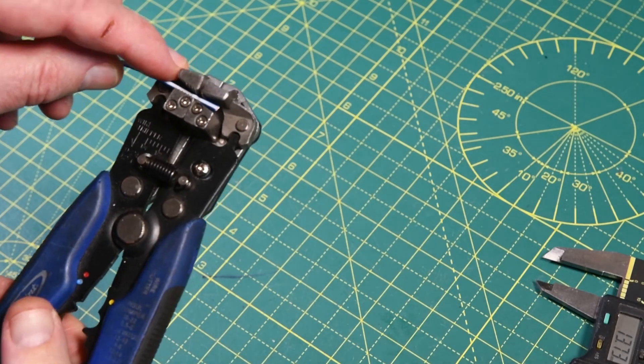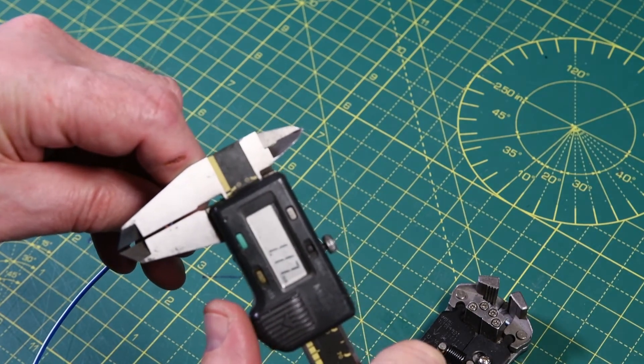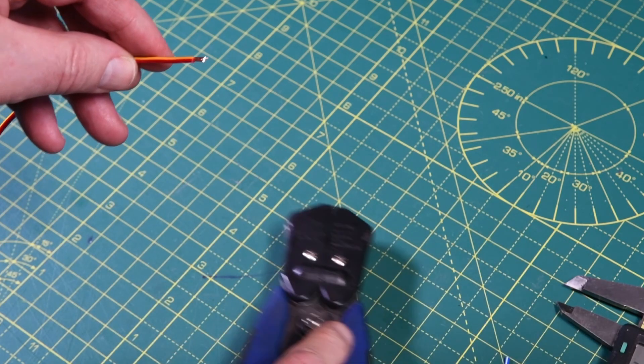That's the O-level maths bit done to show how the wire is measured accurately. We have discovered that sufficient numbers of people are under the misapprehension that to measure wire, one uses a caliper around the insulation. This is very much not the case. If you strip back the insulation and give the strands a gentle twist and measure the copper, that will give you a better idea. The diameter of the copper on 1mm wire is roughly 1.2mm, and 2mm wire will be around 1.7mm diameter.